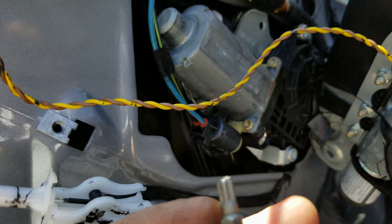There's a bolt over there — you can see this right now. This is how it connects. You see this gap right there — that's where you unscrew the bolts. Lower the window so you can see the bolt, then unscrew them. The bolts are 8 millimeter, so I'm using an extension. Take them out by unscrewing them and pushing on that pin.